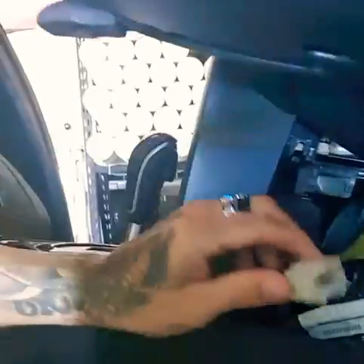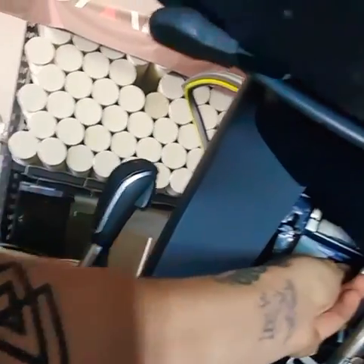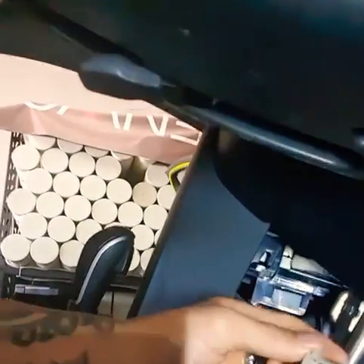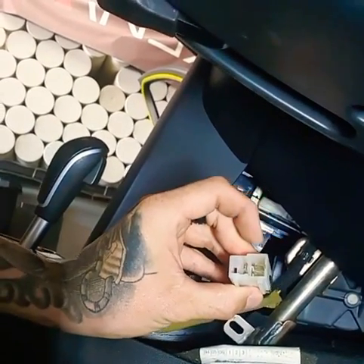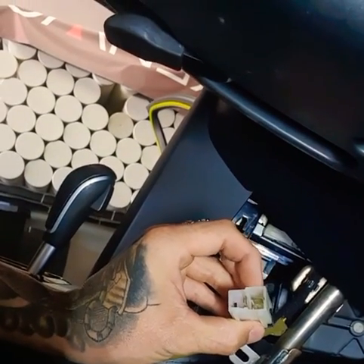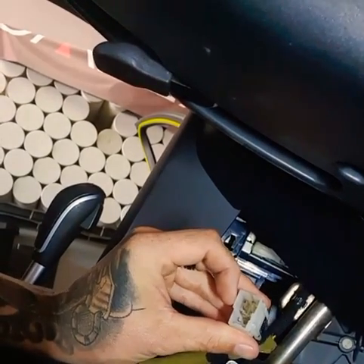We modify this with a particular little addition, which is this fancy blue wire here. What that's designed to connect to is this connector right here. That clips into a little mounting point up here on the side of the audio system — you pop that out to make it accessible. You're going to connect that blue wire in our plug-and-play kit to this pin on this side. Looking at the connector, it's the parallel pin to the left — that is an accessory feed pin for the vehicle.